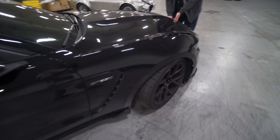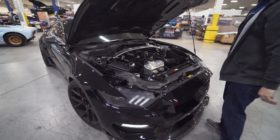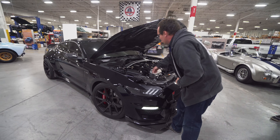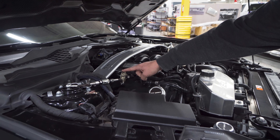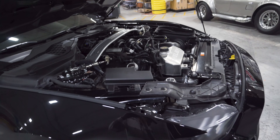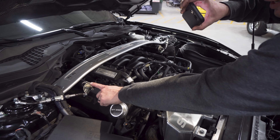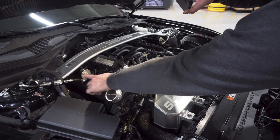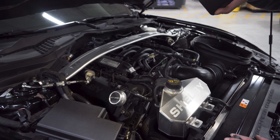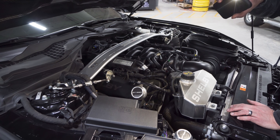They worked on the suspension and we've got some pretty cool stuff to check out. They do Penske double-adjustable shocks — this is the sales manager's car. He's from Penske, so he got the hookup: a three-way adjustable setup with remote reservoirs and quick connects. This is the reservoir for the shocks, and it's got an MR simulator on there. He's a former Penske suspension employee, so he had them make a custom three-way adjustable coilover for this car with remote reservoirs with quick disconnects — so if you have to pull these, the reservoir won't fit through the tower hole and you do a quick disconnect without losing any nitrogen.